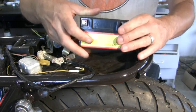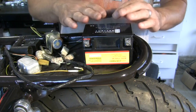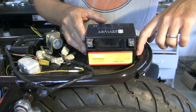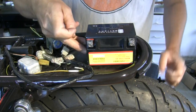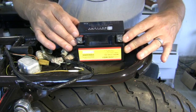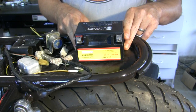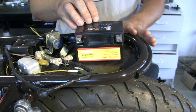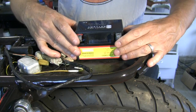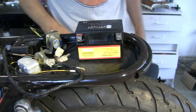I want to get this battery mounted in here. This is an AGM — absorbed glass mat — battery so it can be set on its side. At first I was thinking I could use the back of the frame hoop as one point it could press against, but my cowl comes down there so it needs to be up and in a little bit to make that clearance. I've determined this position is sufficient so that corner does not touch as the cowl comes down, and I want to bring it to this side some because I want to leave space for the potential to install a capacitor bank in the future.